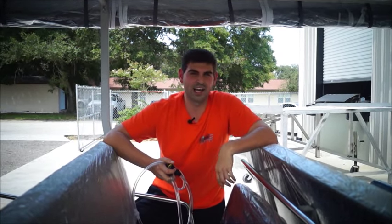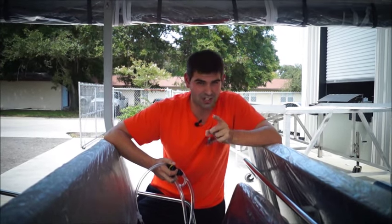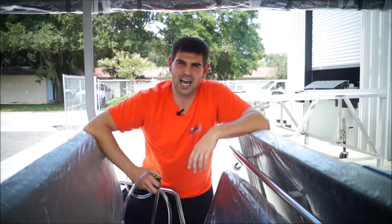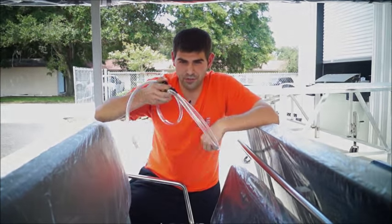It's the best accessory we sell, and I recommend it to any customer every single time that they buy our carts, because the wet batteries last longer than sealed batteries, but you do have to maintain them. So if you have a question, give us a call at 904-247-1818. I'm always available. My team's always available. Let's add it to your next contract, and you guys will have secure batteries and long-lasting batteries, up to 4 to 5 years if you get this option.